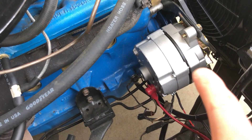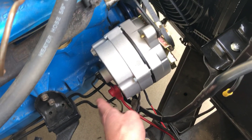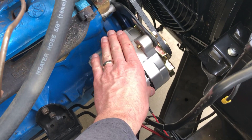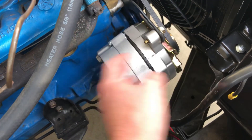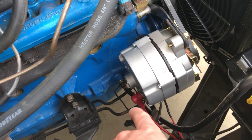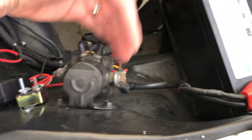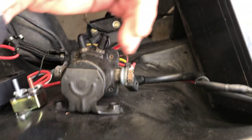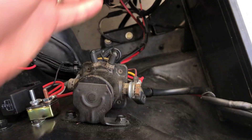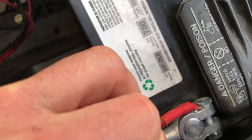Now that I've got both the fan and the fuel injection, I went to a 100-amp one-wire alternator. The reason they call these one-wire alternators is because it literally only needs one wire. You can bolt it up — it gets its ground from the frame. That's not always the best though; you usually want to run a ground to it as well, because sometimes there's resistance going through the block and through the mounts. But very basically, you only need one wire and it goes to the battery. I got asked if it matters where you hook it up — no, it doesn't. The battery cable is huge. If you've got space on the starter solenoid on the battery side, you absolutely can do that. I ran it right to the battery terminal because it was easier.